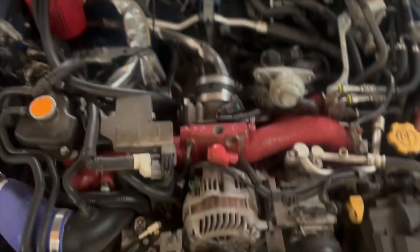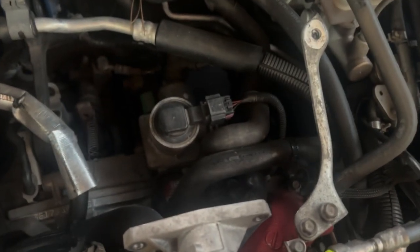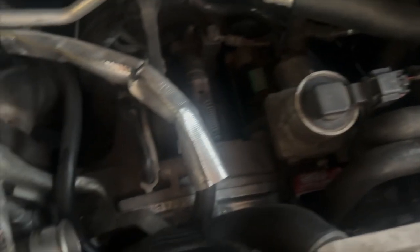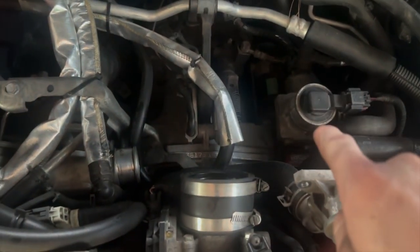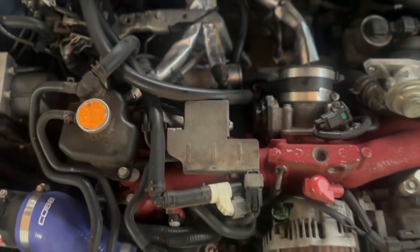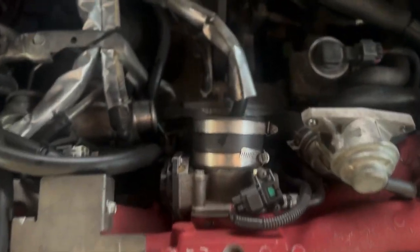The intercooler is off and you can see there's one air pump — it's like a motor — back there, and the other one goes across the bottom like this, then down below by the turbo and attaches to the other head. I think on this one I'm going to have to take the intake manifold off for sure; I don't think there's any other way to do this.